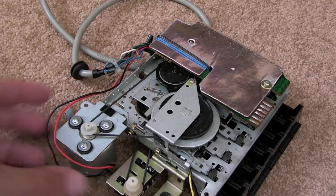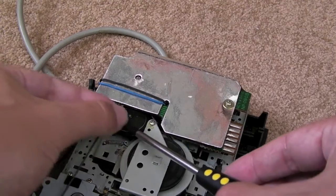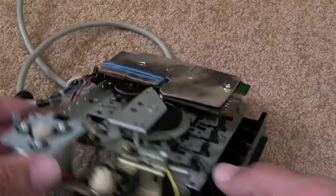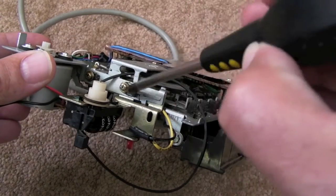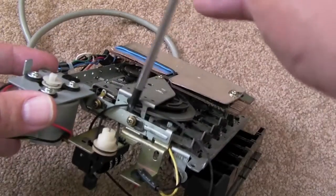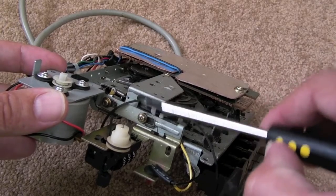He is going to put a Plus 2 belt in the post — it's probably already on its way. Now, immediately this looks pretty straightforward because you could just pull the belt off at this point here. You pull it around that way and off there. I'm going to take these two screws out — certainly that screw there, probably that one — and then this should just lift off, though it's held with a spring and it's part of the mechanism, so you've got to be a bit careful.